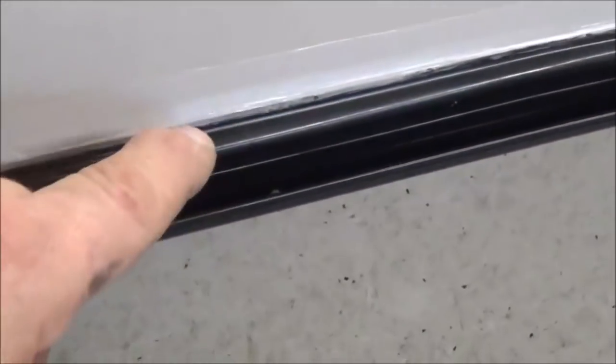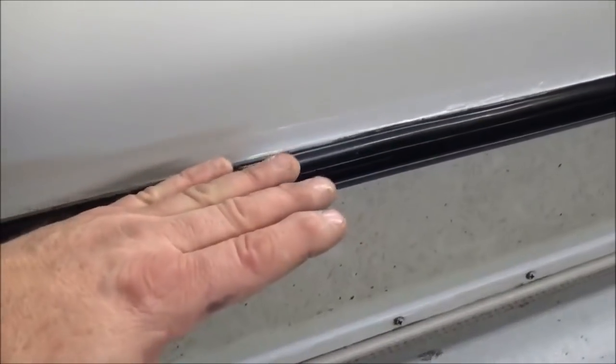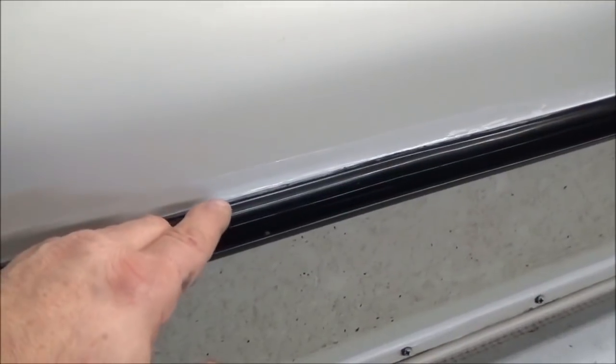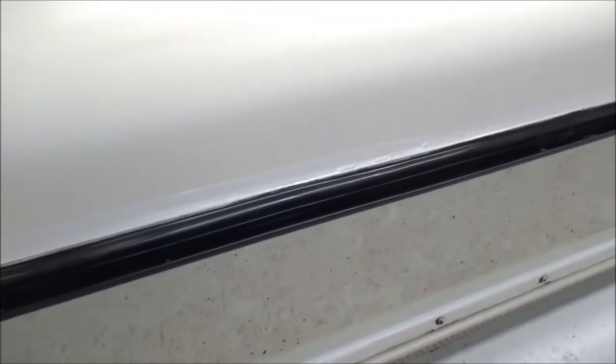This will help literally glue it to the roofing, then we put the screws in, then we put a strike on there. When that strike cures we go back with another strike. If you've ever operated a caulking gun you keep going along and you'll hear it crackle and pop — that's an air bubble underneath there. We don't want those going down the road shuffling and twisting and flexing and that little air bubble pops. So the best way to discourage that is to put another layer on. The chances of having one air bubble over another is slim to none. All caulking is that way — it doesn't matter best or cheapest, it all gets poured into the cartridge the same way.